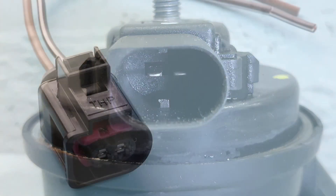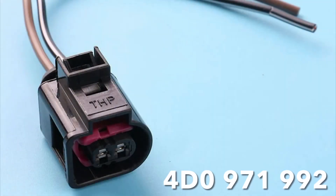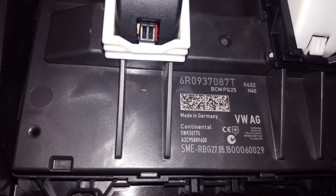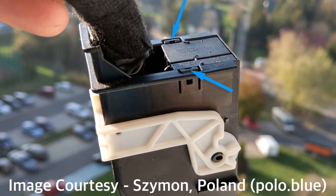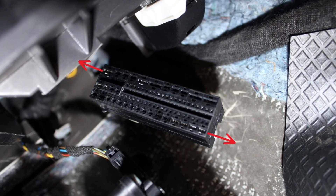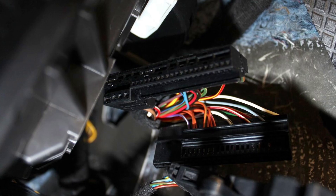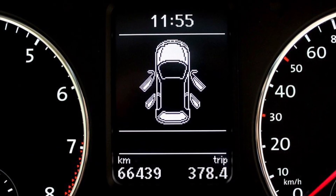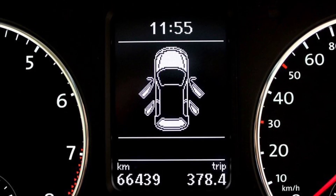Connecting it to the T73A connector is quite simple. The large black connector with a white tab is connector A. Press on the tab and rotate the white latch so the connector comes off from the BCM. Move the two pins outward and pull the black terminals out of the connector housing — they come apart like this. Locate pin number 27, insert the pin, and voila! The bonnet open indication was up on my cluster.